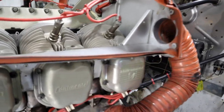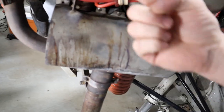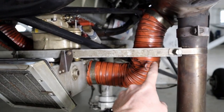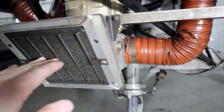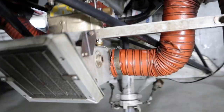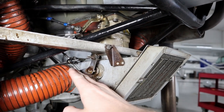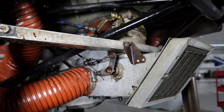Let's talk about carburetor heat. Cold air comes in this tube, comes all the way around into this exhaust shroud — a shroud that goes around the exhaust pipe — and it heats the air up. That hot air can then be funneled into the carburetor heat box. Here's our air filter; we filter the air that comes through here, and typically the air just goes straight up through the carburetor and then into the intake. If I pull carburetor heat, it deflects a valve in there, blocks the clean cold air, and directs hot air up through the carburetor.